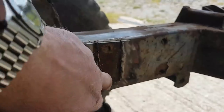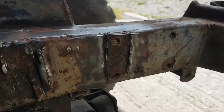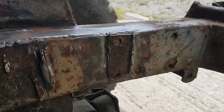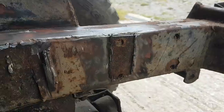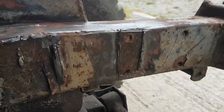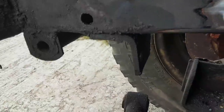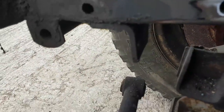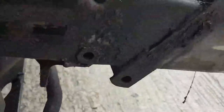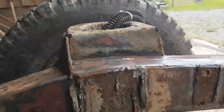It's the other missing bolt holes that I had for the left-hand drive steering box, if it was there. So the patch has come off. I see no reason why it was there. Possibly something to do with the revised engine mount. Now, I just noticed while I'm here, there's another big bracket on the bottom of the chassis over here, which I'm going to have to cut off as well. If I remember rightly, that had the steering support bolted to it.